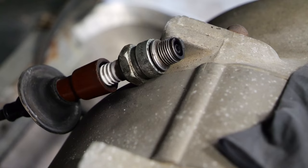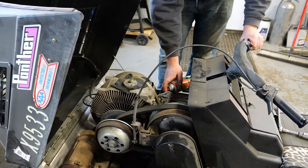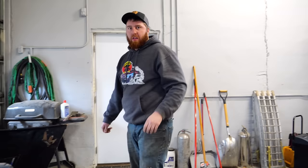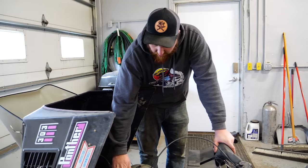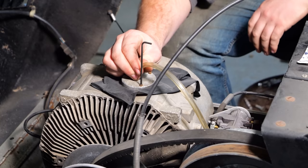Let's see if we got any spark, Mook. Alright, we got spark — still good from last time. With that, let's go ahead and take our pump apart and get the new seals in there. See if we can get this vacuum signal line to work correctly, and then start working on the carburetor end and see if we can get the sucker to run.